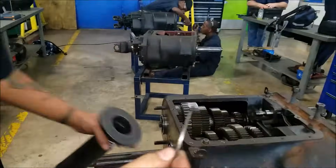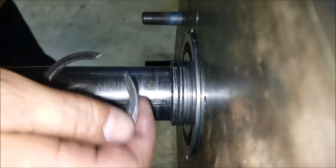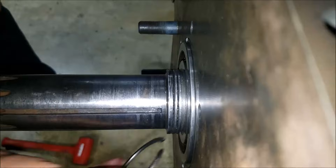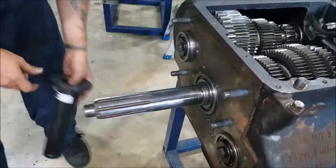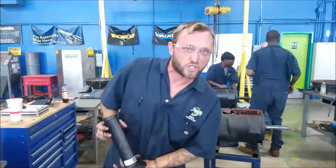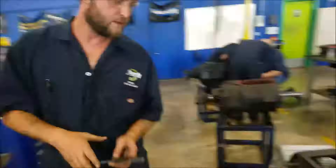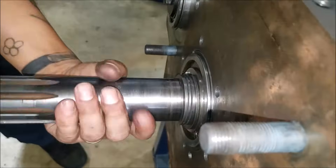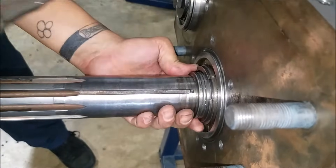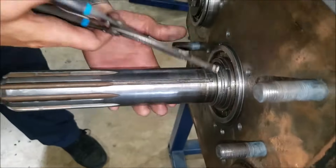You're going to take a snap ring and make sure you've got that groove. See the groove? Here's the thing — it's spiraled, it spins the fluid back in there. Make sure you can fit it on before you try. That looks like it'll go, so we'll give it the old college try here real quick. There you go. That snap ring's a little bent, but it is a trainer — people mess these things up. You would definitely not want to put that back on in real life.